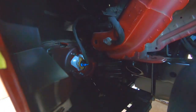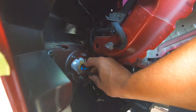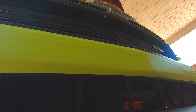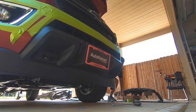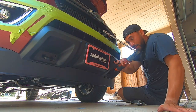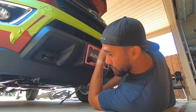Go ahead and disconnect both of your fog lights. There's just a little clip right here — push down on it and pull it right off, it's pretty simple. Right here in the groove there's a 10 millimeter — I need a real long extension to get up in there. This is that three-eighths Milwaukee I was talking about; it takes a lot to get in there.